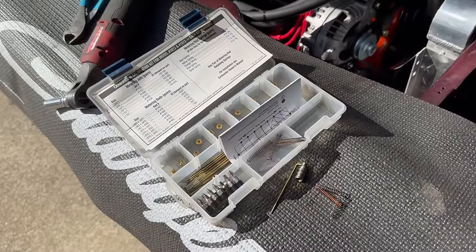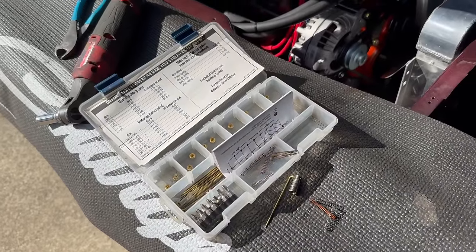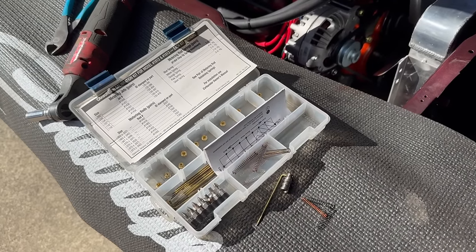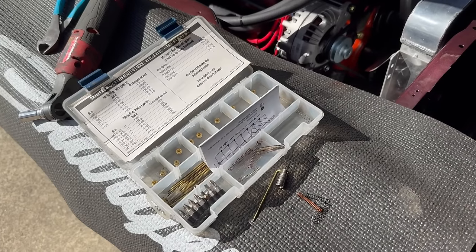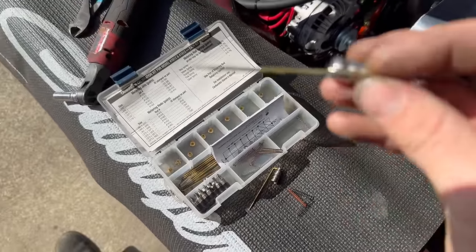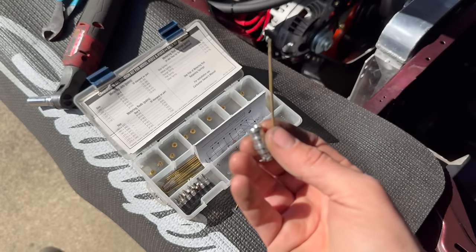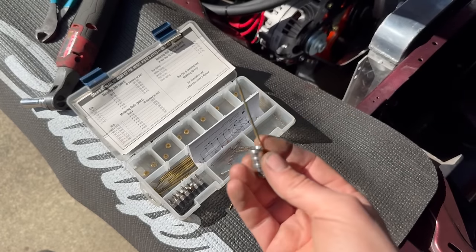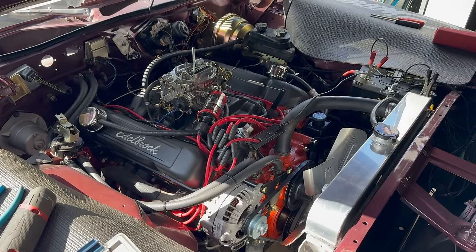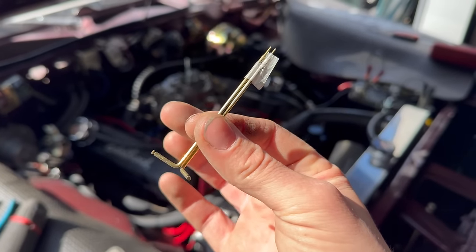I really want to work on the timing here, but I kind of need to take a detour through the carburetor now. This is an Edelbrock 1411. Apparently, they come stock with a 110 main jet instead of the larger 113. And the needles are interesting. Yeah, we're not going to be able to read that. But it's a 7547. That's super lean cruise and pretty lean on the power side, too. Because I have the step-up pistons out anyway to change the springs for weaker ones, I'm probably going to go ahead and try some 7037 needles and see what that does for us.